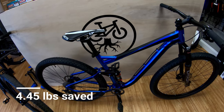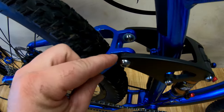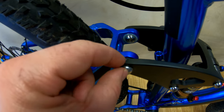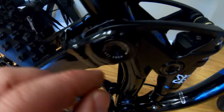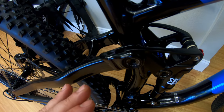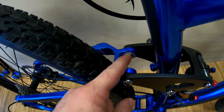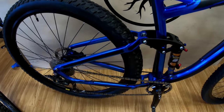Is this worth a $550 upgrade? Definitely upgrading the shock, rear shock, drivetrain, and wheels will make it a lot better bike. But you still have compromises. On a nice bike you're going to have bearings in these pivot joints — these are not bearings, these are little plastic bushings. Bearings in the pivots would be a lot smoother and last a lot longer. I don't know what's going to happen long-term with these bushings, and if they do break, where are you going to find them? Good question.